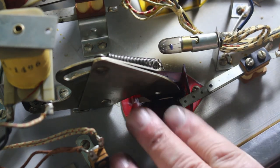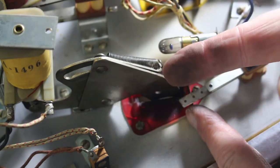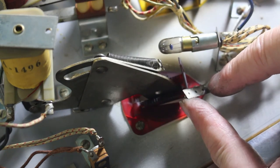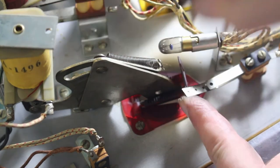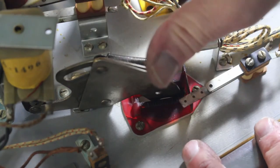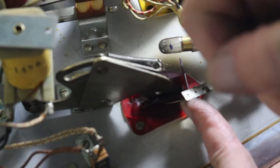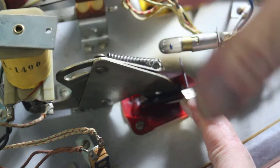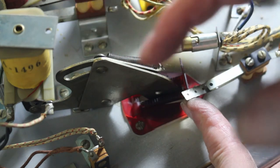And how these ones work is when the ball falls in the hole, there's a little lever inside that it hits on. It comes up and turns on the kicker, the kickout. But this coil is turned on by another relay. There's a set of relays for each hole. The ball falls in, trips the other relay. The relay closes, makes contact, gives you your points, whatever else it's supposed to do, like an extra ball or a bonus. And then at the end, it goes to the scoring reel.